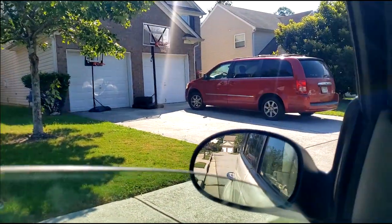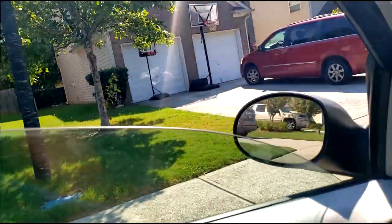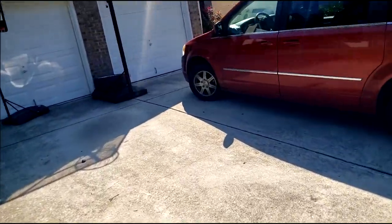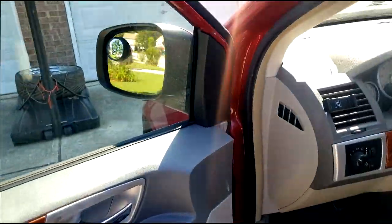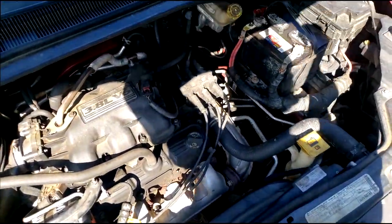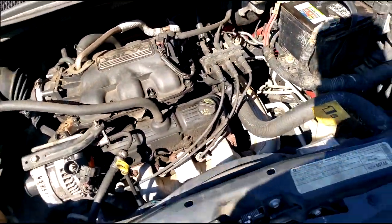Now, I highly suspect there's something wrong with the transmission. You can pretty much gauge a transmission as dying a slow death. Well, I don't operate like that, guys. Transmissions don't necessarily die, however, parts wear out. Torque converters wear out, which will make a transmission appear or come off as being dead, as some people would call it. Well, I did have some fault codes in the transmission a while back for things like 2-4 pressure switch, solenoid pack type codes. I can show y'all the codes when I pull up the screen, but for now I have to get this thing to the shop so I can proceed with fixing it.